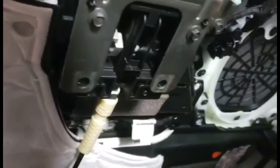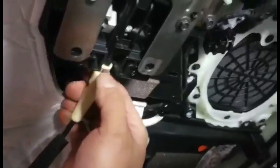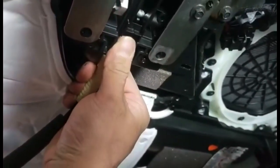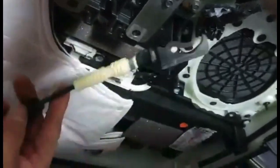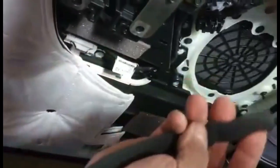There you go — that's how you remove your side mirror. To remove the plug-ins, just push this thing and then pull it out like that. Kind of tricky on this one, not really — it's not really hard. There's a plastic clip right here on the bottom, push it down and then pull out the whole thing, and there you go — that's how you remove your door latch cable.